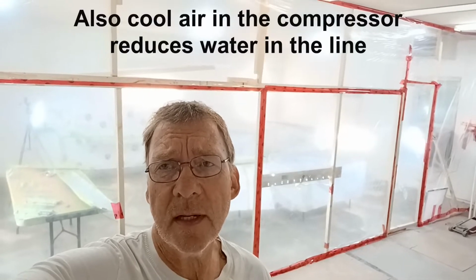It's a little cool right now, but I'm using that to my advantage because that doesn't contain a lot of humidity. So what I'm doing is I am now running the fan. I've gone in, I've wet the floor. I've already used the high pressure nozzle to blow all the surfaces down, the walls down, everything, just trying to get the dust kicked up. And hopefully the fan is now evacuating that dust. Fresh air is coming in through the new filters. I'll go in a couple more times with the high pressure, blow the air around.